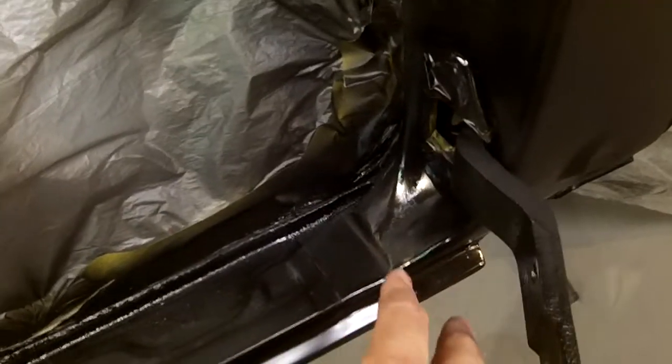Now the fender fits really nice. I've got a 3/16 gap all the way up. This bracket is in the right spot, which makes me think that the rocker was just wrong. So other than that, hinges are staying in, obviously, and I had a little bit of body work on all these spots here where the pillars meet the rocker. This was all braced, like from here to there, and then from here to there, and then the whole bottom of the car cut out.